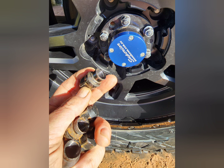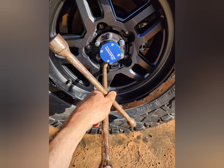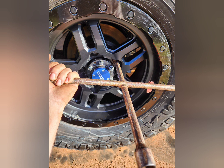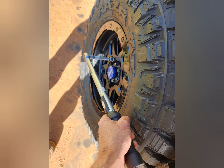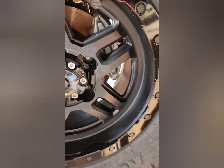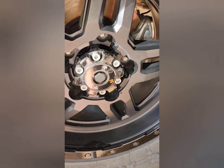After you've finished cleaning your car after a weekend in the mud and you've had the wheels off, there are a few things to check. Make sure there's no mud or grime in your wheel nuts or on your studs — give them a good clean. Tighten your nuts up finger tight only for the first rotation; the idea is to get the wheel to seat properly and centred. Use your torque wrench to do a firm but not tight rotation of the nuts, then do a final rotation of all the nuts in sequence until the torque wrench clicks. I also like to do one more pass to make sure all the nuts are at torque, just in case the wheel hasn't bedded properly and one of the nuts feels a little loose — that indicates something has gone wrong and you should investigate further.